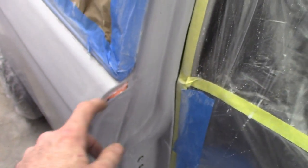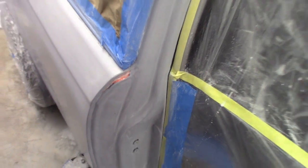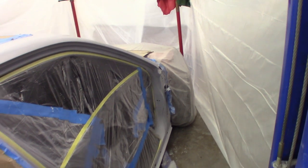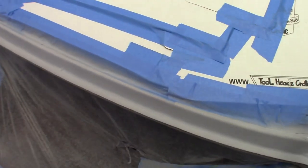I went back and had to sand out the door jams — it was bubbling a little bit from the last paint job. Whoever painted it orange did a decent job, but that black over it was clearly rushed. Not too much work left now: the doors, the bumper, the fenders one at a time, and the trunk lid. Then we get this back together.